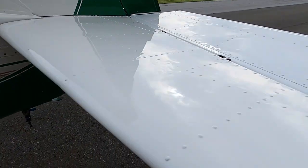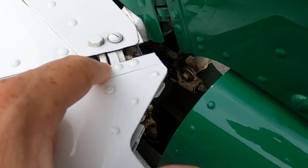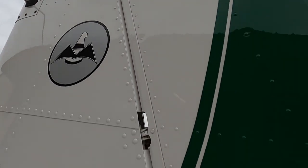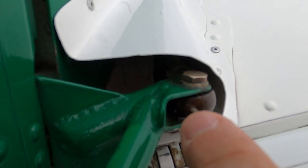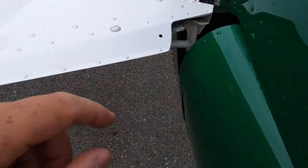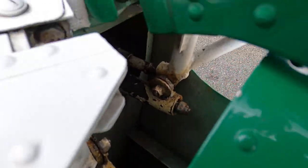There's another inspection door right there. You want to check these bolts when you walk around and make sure everything is good — there are four of them on the vertical stabilizer. On the rudder, you have one here and one up top that I check on my stool. Check to make sure nothing's loose. Here's a push rod — everything is push rods in the Mooney. You want to check the bolts, make sure everything is tight, and nothing is loosened or working its way out. Very important.